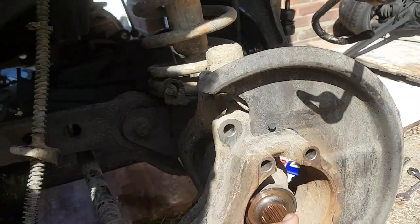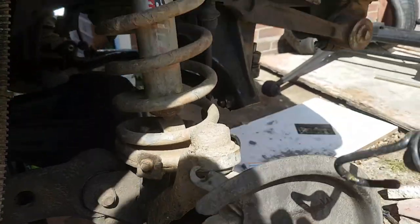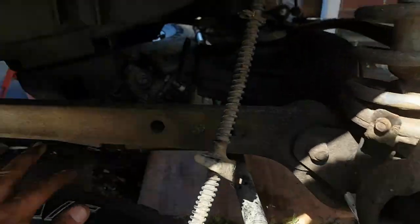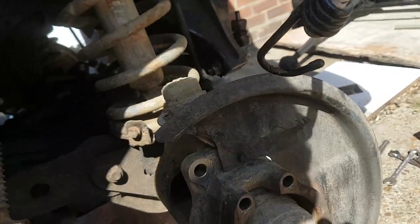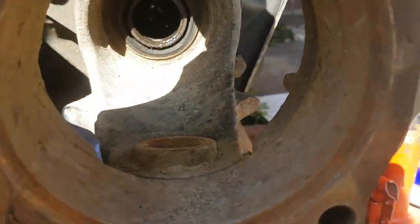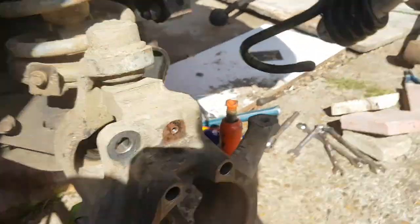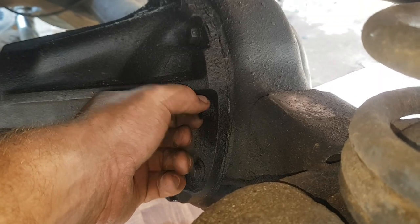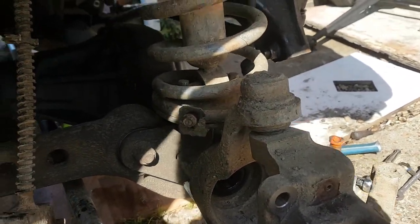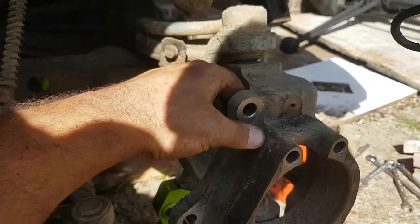Hub's out — new bearing, as you can see. I'm going to take the shaft out because obviously I'll be keeping that, it's good. I'll undo that bolt I'm pointing at. I've got the nut off for the steering, just got to get it separated, undo this bolt, then two little ones, and then this side is basically ready to remove. The shaft is out, which I'm very pleased about. Unfortunately this axle is scrapped — underneath it has been walloped really hard by the previous owners and is very slightly bent. Shame, but one of those things.